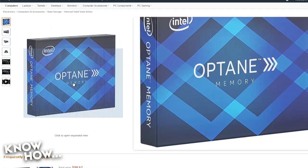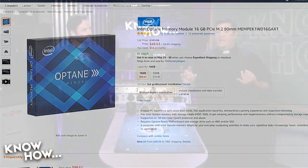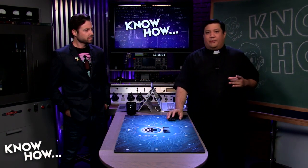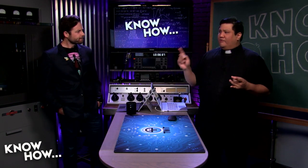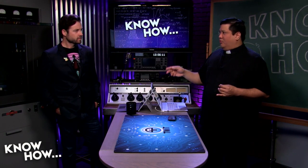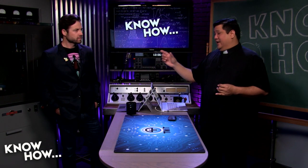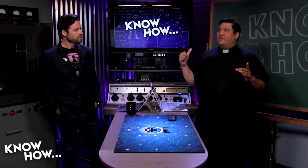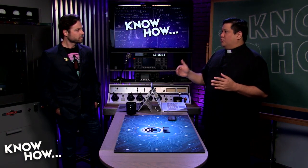It isn't. They're billing this as cache. So this is cache for a hard drive because it's actually pretty fast. It's not as fast as CrossPoint can be, but you're talking about something like 1,200 megabytes per second read, 280 megabytes per second write, which is not as fast as the fastest M.2 SSD from Intel. Right. But it could do 300,000 IOPS read and about 70,000 IOPS write.